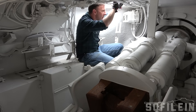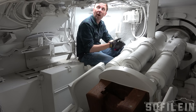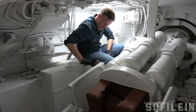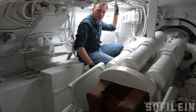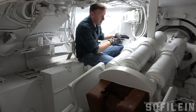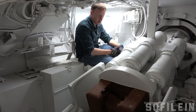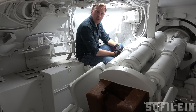Talking about the driver's position, I have an all-around vision cupola. Of all the World War II era vehicles, this is probably the best visibility for a driver because you can actually see 360 degrees from this position. The seat — this is actually the seat mount, I'm missing the cushion in the back — is adjustable, and right now it's up in the topmost position. If I'm driving behind our own lines moving towards the front lines, I can have my head out of the hatch and the seat adjusted fully up. The controls are long enough to operate from both a lower and a higher position. Once we get to the front line, I operate a lever on the side, the seat collapses down, I close my hatch, and now I'm looking through the vision blocks in the cupola.